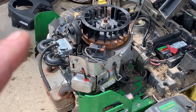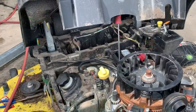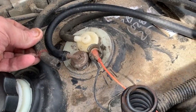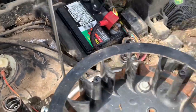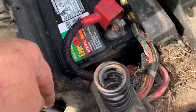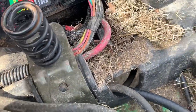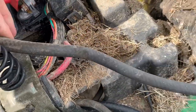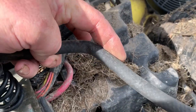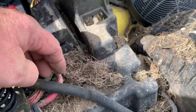The fuel pump wasn't pumping hardly anything — barely anything. What it was doing was sucking fuel through a restricted fuel hose. Let me lay this old fuel hose up here next to the new one. I want to show you this crook in the fuel line right there, where it makes its transition — right in behind here where you can't see it. When this fuel line gets a little bit of age on it, that crook right there was enough to pinch off the gas flow to the carburetor.